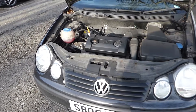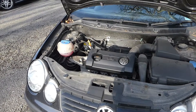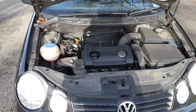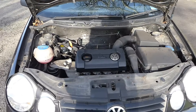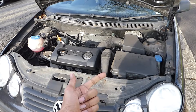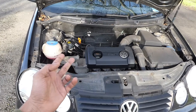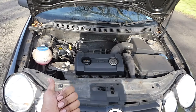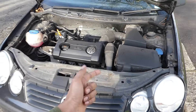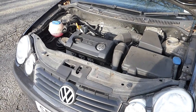Hey, what's going on guys. This is a video about the camshaft position sensor in your Volkswagen Polo — it's actually quite a common problem where the sensor goes bad. A faulty sensor can cause a number of different problems, from acceleration to idling, and it can even make your car stall more often. I'm going to split this video into three parts: diagnosis of the problem, the symptoms like acceleration problems, and replacing the actual sensor.